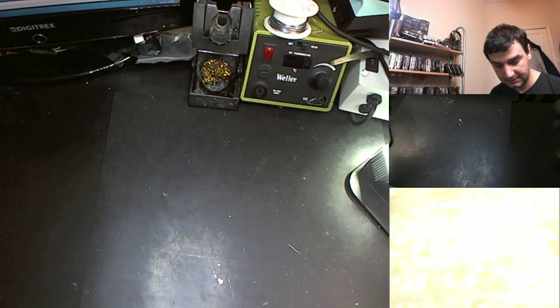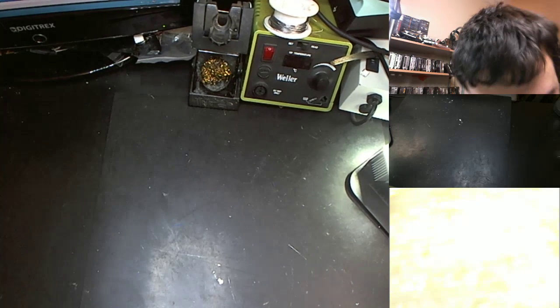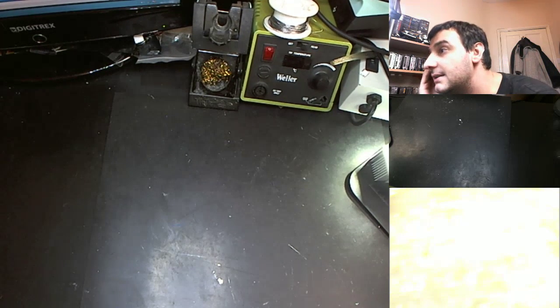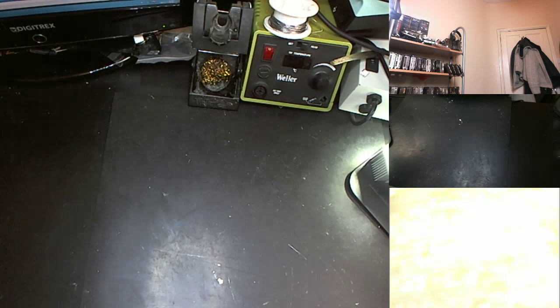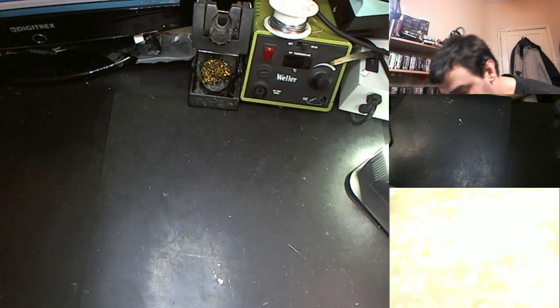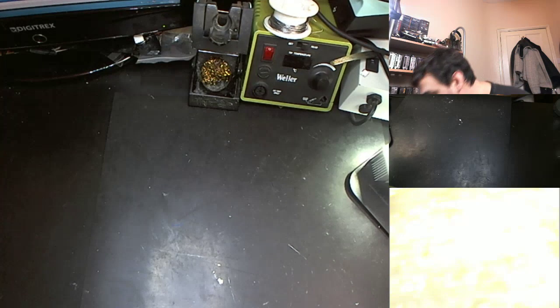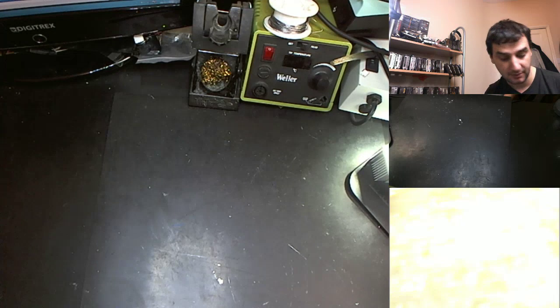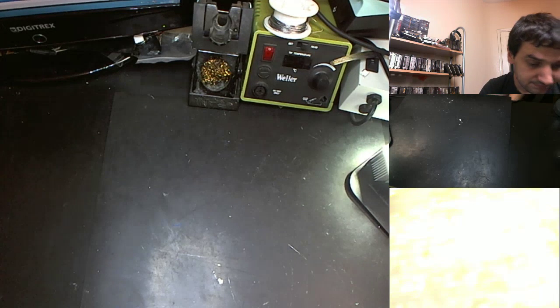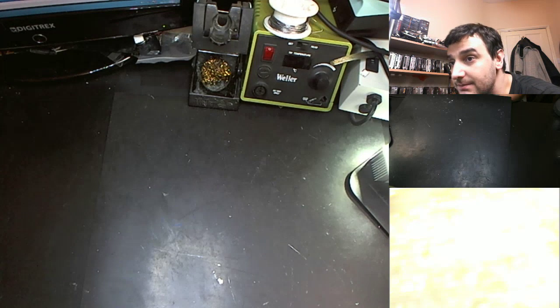This is one problem, but I'm wondering why it doesn't do the white screen. Yes, this is a white screen problem, and it's from the LCD cable. If it's not the cable, then, sorry for my language, it's your fault, you know. The main board, you need to take the main board out and see what's missing, what voltage is missing. And maybe you can find the diagram for the notebook, but that's it.